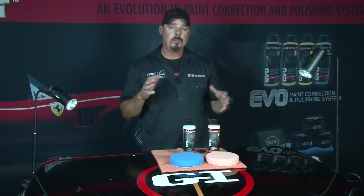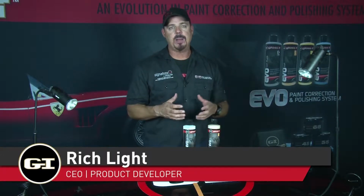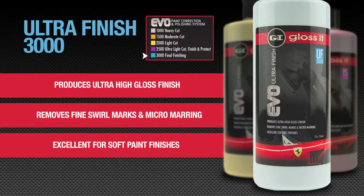Now going on to a different pattern product combination with the Evo paint correction and polishing system, we're going to talk about how to use our Cut 1500, which is a moderate to somewhat aggressive cutting polish, and we're going to be using our second step for our ultra finishing polish, which is our 3000. The pads we're going to be using with this demonstration on repair and restore is for what we call conventional or OEM clear coat finish.